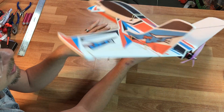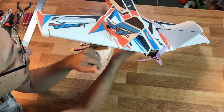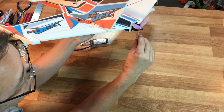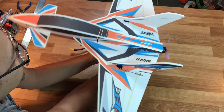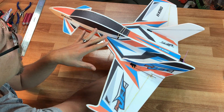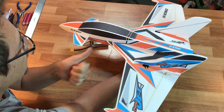So this morning I flew and I put on one of these tri-blade props — a 50-40 RaceCraft three-bladed prop. I know that when I land I'm going to scrape them, but they're very flexible so it actually didn't have any problems this morning. The torque issues pretty much went away, which was nice to get rid of one issue.